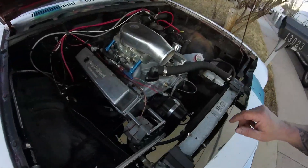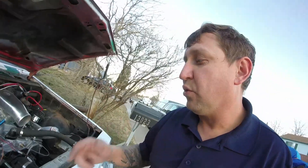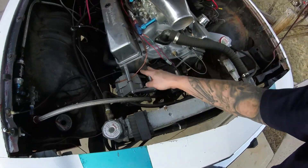These were a new old stock set. The initial plan was to put an LS in this thing, but the Gen 1 just makes more sense for now. I may end up fuel injecting the thing. It does have a cheapy dual-plane intake on it that's got the Vortec pattern. These Blueprint heads have the Vortec and the old-school 12-bolt pattern — this is the 8-bolt. Those go in straight up and down and they have a better intake gasket. It's all wired, the stuff all works. It's got a Turbo 350 in it that's all hooked up. It's got a 7.5-inch 10-bolt, which is kind of its Achilles heel. Eventually I'll put a rear end in it. This may actually end up being my fast car because I kind of don't really care about it.